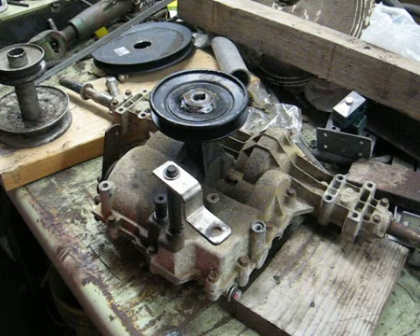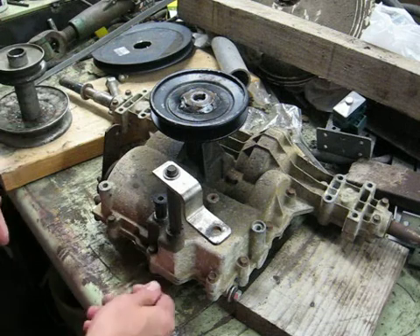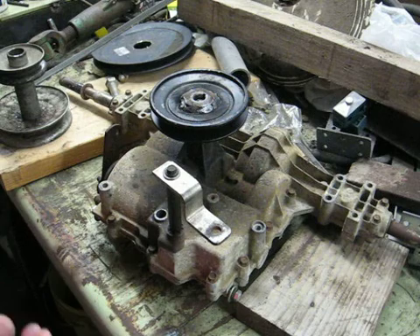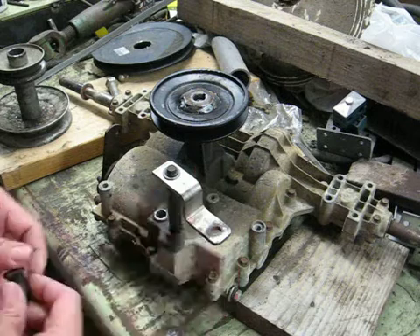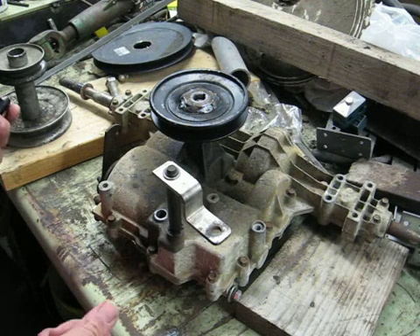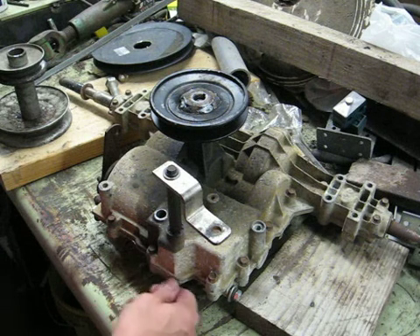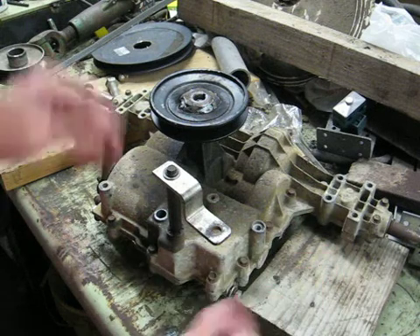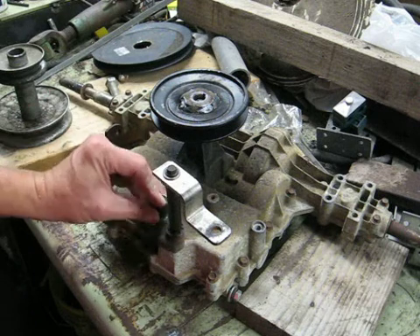I've done it for years in pulling tractors and other things. The oil-filled rear end is the point. The older 930s and 920s are bentonite grease-packed cases — they're not made to be serviceable. They're made for a homeowner who never touches a thing and doesn't know how to pull a drain plug. But those of us taking these out and running them in hard use probably want to check it every now and then. Just make sure the oil level is up to the centerline of the case where it's into the bearings and through the centerline of all the shafts and into the axles to get proper lubrication throughout. If it's low, you can refill it.